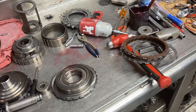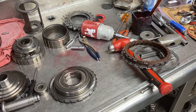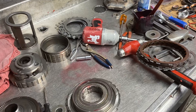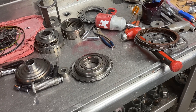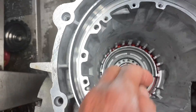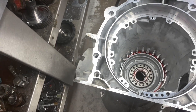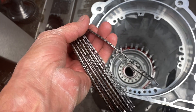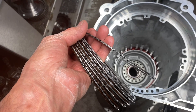The clutch has to come off when it shifts into second gear. When we put a big band in it and modify the circuit to shift into second gear, we're going to bring that band on a lot quicker than before. We need to allow time for the low reverse clutch to get off. As long as the wave is in there relaxing, the clutch is still on.